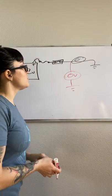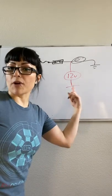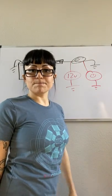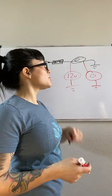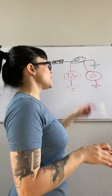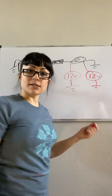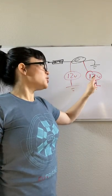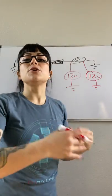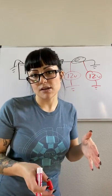Let's say we've got 12 volts at the load. Next test — since I'm already here — is another available voltage test on the other side of the load. If I see 0 volts coming out while pressing the switch, my component is faulty — it is open inside. If instead I see 12 volts, it's not my component; in fact, the fact that I see 12 volts means there's a connection inside, so the problem is generally going to be a ground side problem. If there are junctions in between, test where the easy junctions are, and once you see no more voltage, you know that's where the break is.